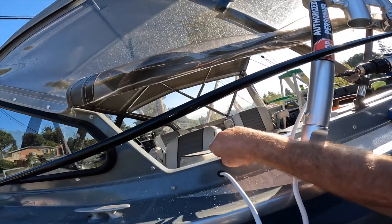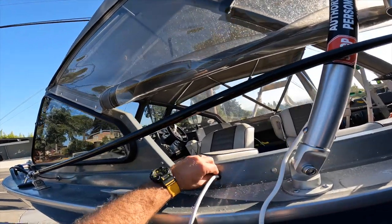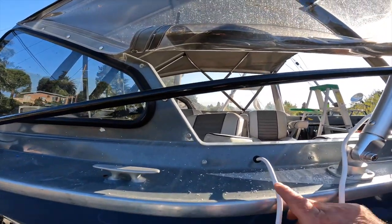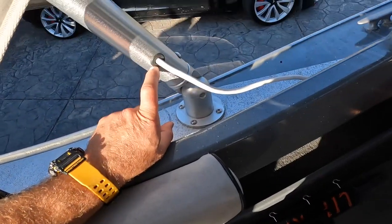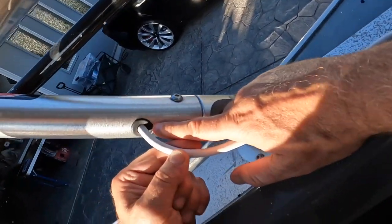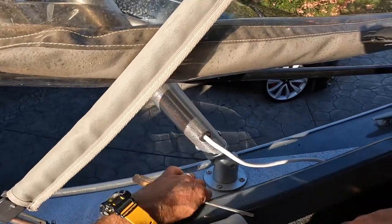The step-down bit makes short work of it — that's it. Now let's fit a proper grommet in there. Look how it sits — that's the proper way to fit a grommet on a round hole. We'll seal it up after all the hookups are done. The cable fits nicely through it. You can also cut a grommet in two and shove it in place with a screwdriver — pretty good seat.